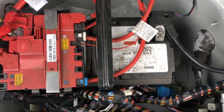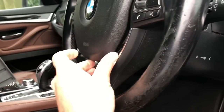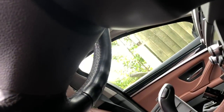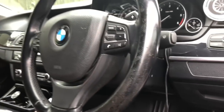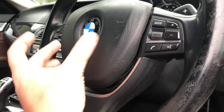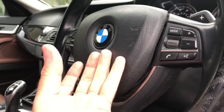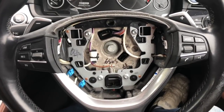I've just started removing the airbag — you can see it's just started to release but it's not free yet. The release hole — there's only one — it's right in the center at the back of the wheel. There are two pins that hold it in place, and a central wire that connects them both, so you need to push that to release both sides. I've released one side, so I just need to press it again and the whole thing should pop out.